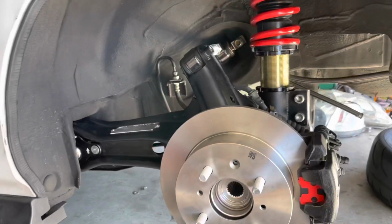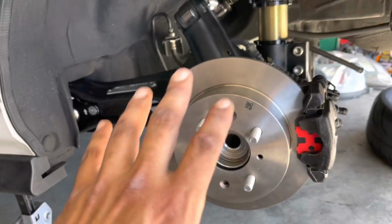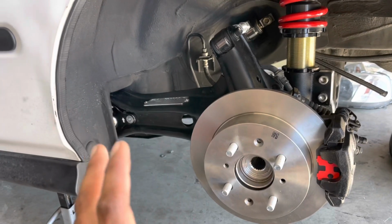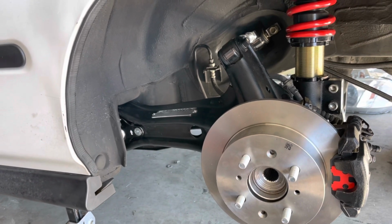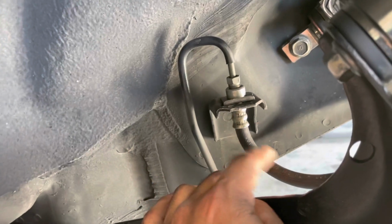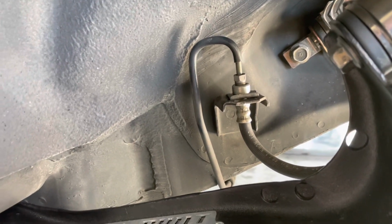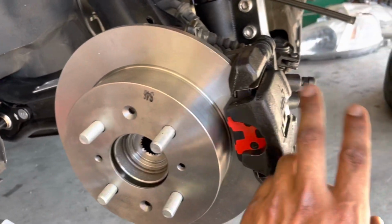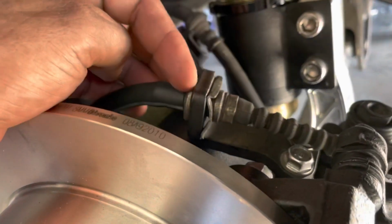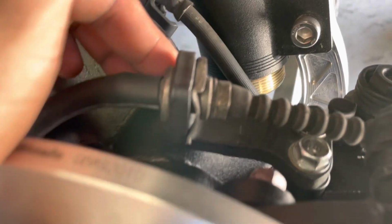Hope you guys are liking the build. There are some modifications you will have to do, so I'll give you a heads up. They do sell pretty much everything to replace what I'm going to explain, but I like to use as many OEM parts as possible. If we don't have to buy a part and can utilize the OEM part, I'd rather go that route, just because of OEM quality. So now, what I did, a lot of guys are using extended brake lines or those fancy brake line tuck kits. So what I did, I utilized the OEM Si rear brake line, which is what my rear calipers come off of, which is the same as EX, I believe. Nothing changes. We added the original e-brake bracket because on the all-wheel drive, the extra hub material for the axle won't let this bracket clear.